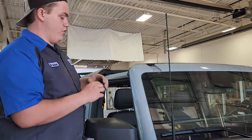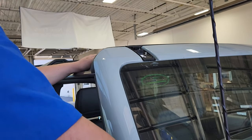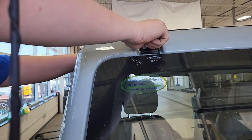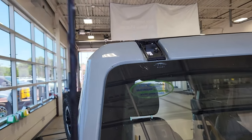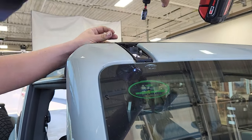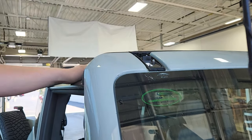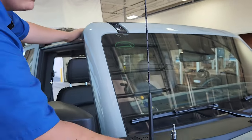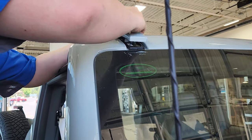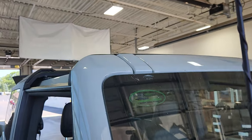After you move your roof rack, you want to put these paint match covers where your rack was mounted. First install the black plastic — you have two 10mm nuts that go on the studs on the vehicle. Go ahead and tighten those down. Once you get those snug, take your paint match cover and snap it in. So you bolt it on, then that just snaps in. That's it.